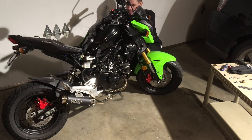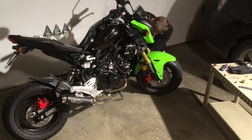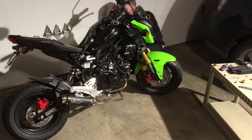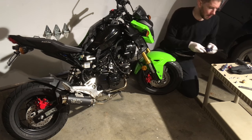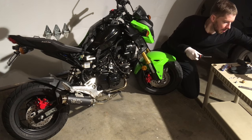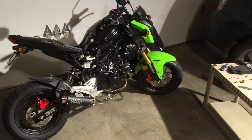So after I was done with this installation, I let it warm up for 3 minutes and then took it easy for the first few minutes while the engine was warming up, and then got on the highway and let it rip. And it definitely has more highway performance with the aftermarket exhaust just by itself with the paperclip reset of the ECU. Once the power commander and cold air intake are installed, you can feel even more. Around 6,000 to 7,000 RPM it starts to pull more, and it helps you keep up with traffic at 50 to 65 miles per hour better.